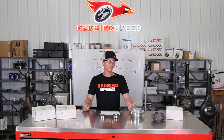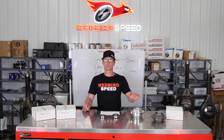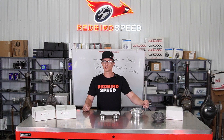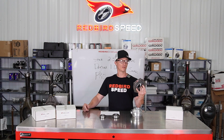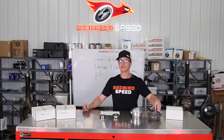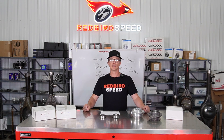There are a few oddball center sections where some people use a ball bearing. When you're buying pinion bearings, you've got to make sure to match them up to whatever situation you have — your pinion support, your aftermarket case. Right here you have a nodular iron pinion support and it's a Daytona style, so some people might confuse that for stock — it's not stock, it's aftermarket and takes a bigger bearing, a lot stronger.